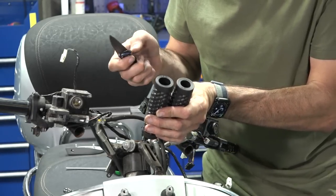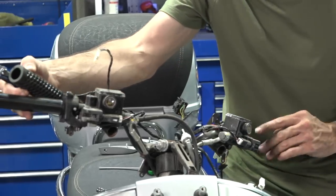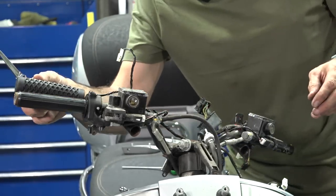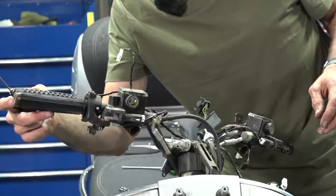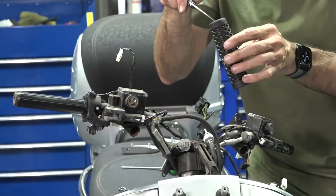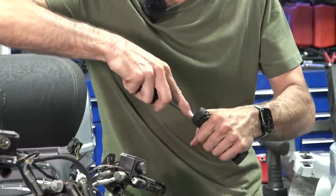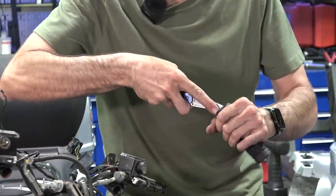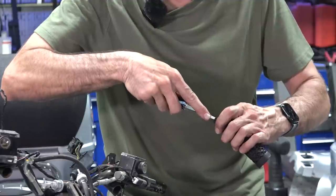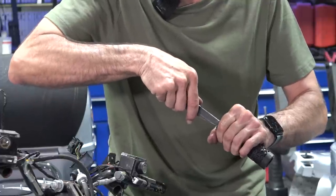When you buy standard grips, you'll see one is a little bit larger — that's the one that goes over the throttle tube. Hold off on that grip until we get the handlebar covers back on. The grip doesn't have a hollow end. Here in the workshop I have a specialized tool that will punch that out, but if you're careful with a sharp knife you can just carefully carve the end of the grip out. The bar-end weight is going to cover it, so don't worry — it's made of rubber and will cut pretty easily with a sharp knife.